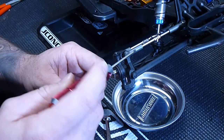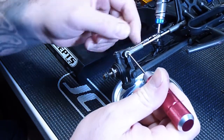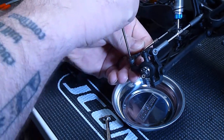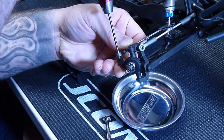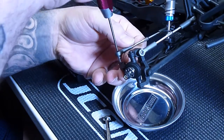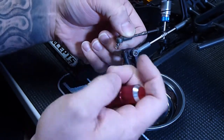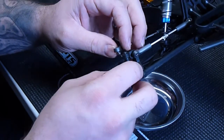What I'm going to do here is take this — what they call the turnbuckle. This is the ball stud inside of here. These are really nice on Team Associated because you can put them in and take this off. I'm going to take this one back here off. Here's a good little tip: if you constantly pop these ball cups off your ball studs all the time instead of screwing it out the top, these will eventually wear out and pop off if you bump the wall when you're racing. So that's just something to remember.